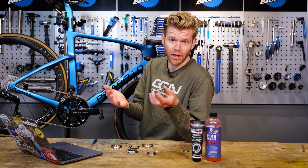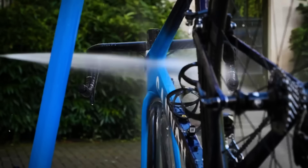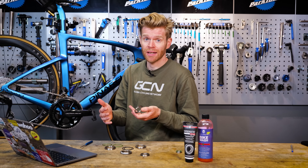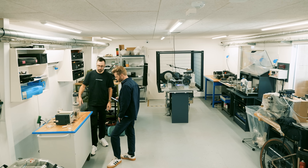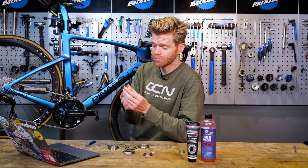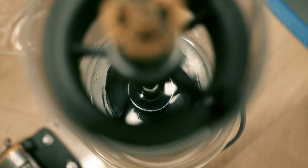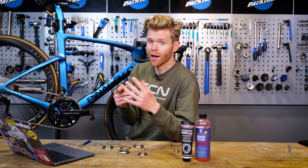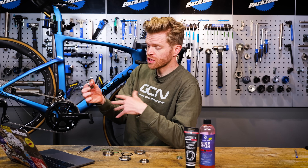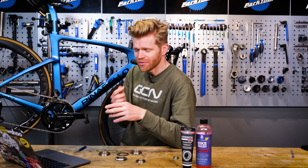I've made videos where I've said you should jet wash your bikes — it's fine. This was mainly done because pro mechanics do it all the time. The reason we now know this is not the case is because it's been studied and investigated by engineers at Ceramic Speed, who have shown me their results. What they found is that it's actually quite easy for a jet washer to overcome the seals on a bearing and for water to permeate through. Once water gets into the bearing, it causes a number of problems and it's quite hard for it to come out. The engineers told me the first thing to be aware of is that the water, once it gets in there, doesn't just dilute the grease — it can change the chemistry of it, which as a former chemist I found really interesting.